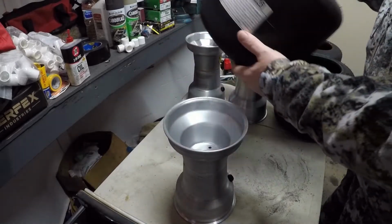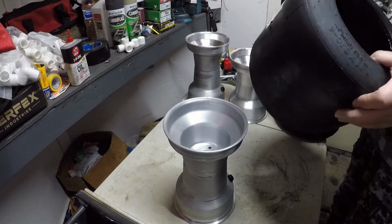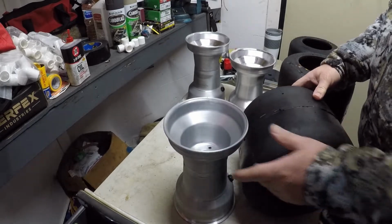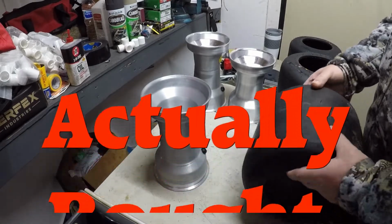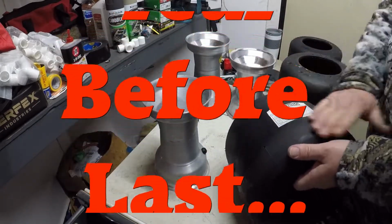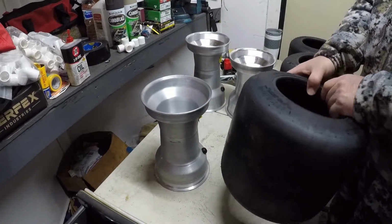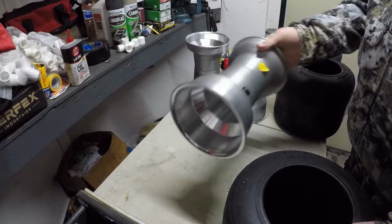Alright, this is the right side tire. It's 11 by 8, 10 by 6. These are Burris SS 33A tires right here, and most everywhere we run, that's the tires we use. And these are 2020s. They're brand new. Bought them last year, because you got to have a different selection of tires, different year date codes, and different cuts. There's a lot more to this kart tire game than anybody realizes, and it's one of the hardest things to learn, and you learn something new every day.